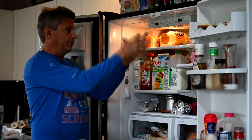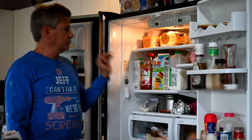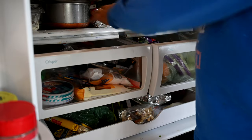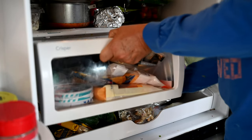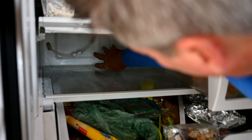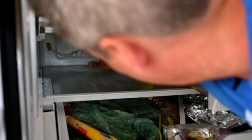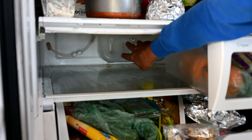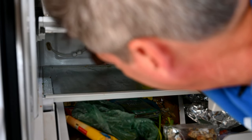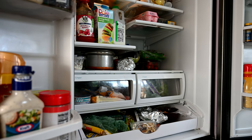We're here for the main repair, but we'll also show you how to test your water inlet valve. We're assuming you've already checked the water reservoir — in most refrigerators it's behind the crisper drawers. That sometimes freezes over, which is one of the most common reasons for no water flowing. To fix that, people use a hot air dryer to melt the ice in the tube. But in this case, we know that's not the problem.